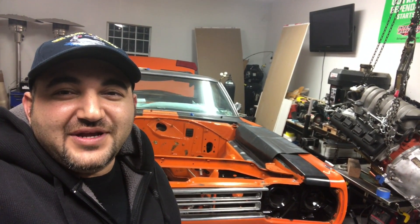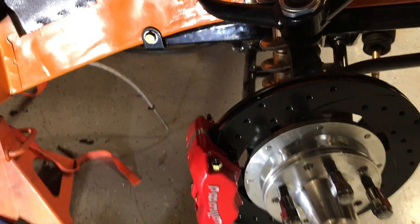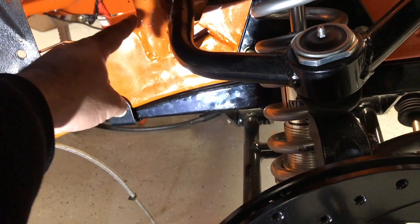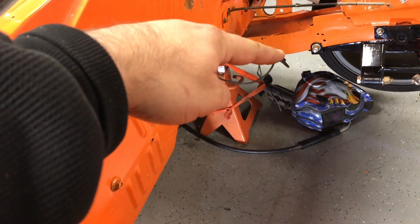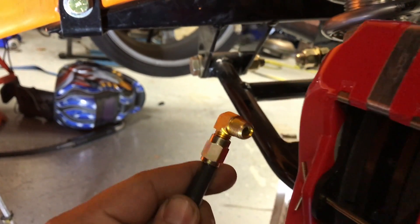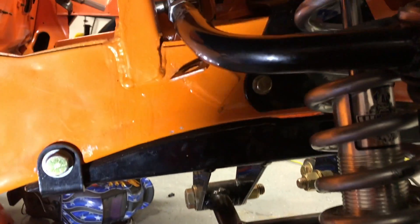In this project we're going to attempt to do the brakes on a stainless steel line, form all the lines, and go from there. The idea today is to run the brake line from the flex hose to the caliper, then back up, make a hard stainless steel line that goes back into the engine bay, up and over the arch, back around across the frame rail, and then come up to a booster on the caliper side. It's really easy — just a 90-degree and we'll attach it there.